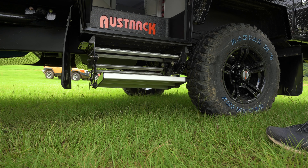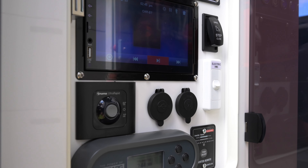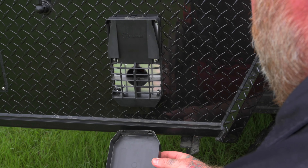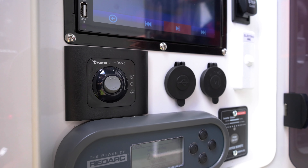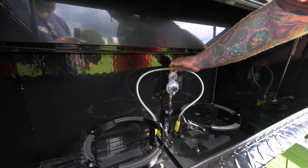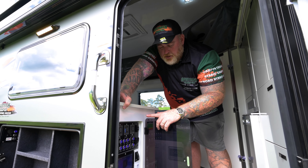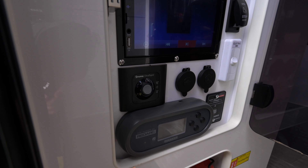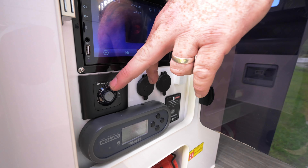This switch is for when you're plugged into mains power and using your hot water off mains — flick that on and 20 minutes later you'll have hot water. If you're off-grid, use the gas hot water switch. Make sure the vent cover is off as shown outside, your gas bottles in the front compartment are turned on, then flick it to either 60 or 70 degrees. You'll hear a little click and in 20 minutes you should have hot water. If a red light comes on, something's wrong — put it back to neutral, check the vent cover is clear and the gas is on, then try again. When not using it, always make sure it's off; you don't need the gas switch when using electricity.